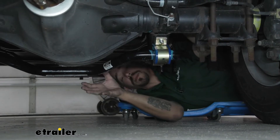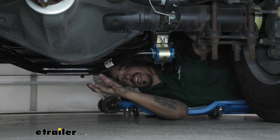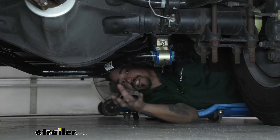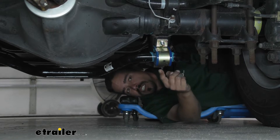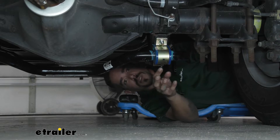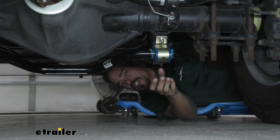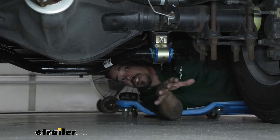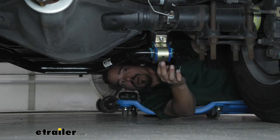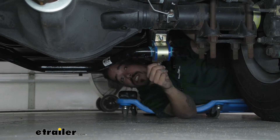The bar itself is going to be extremely durable — it's made out of 4140 chromoly steel, so it's not going to have a whole lot of deflection or bending to it. Another thing to help out with the stiffness and the support is the fact that it uses all polyurethane bushings. Those are going to have very little deflection to them as well, but they are going to be lubricated, so they're going to provide just enough rotation and flex so that when we do turn, our suspension still has enough room to move, but it gives us the support when we need it and allows us to articulate our suspension at the same time.